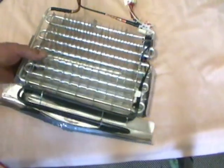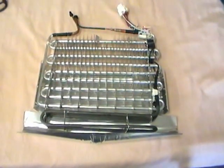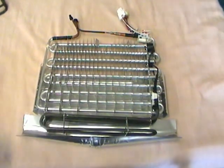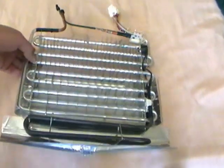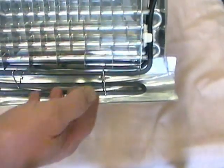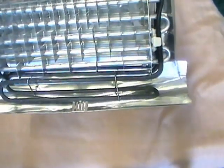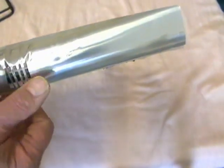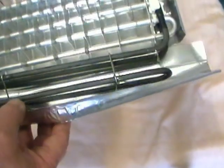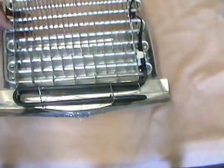Of course, if you're a refrigeration engineer and you know how to do a system, you could just replace the whole evaporator assembly. The aluminium tray is heated for draining the water away through that grid, and the heat of this element not only defrosts the evaporator — it's supposed to keep the tray clear as well. I personally think that those holes are just going to get blocked with rubbish, and then it'll ice up and all go wrong.